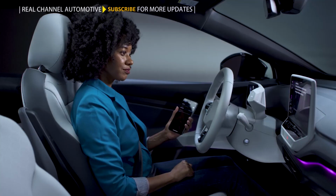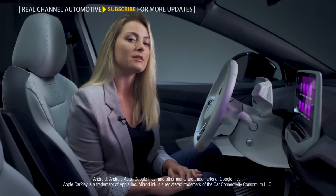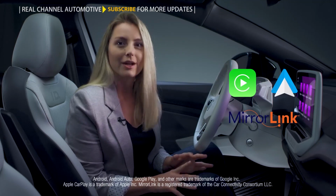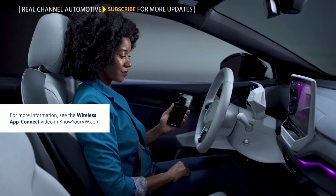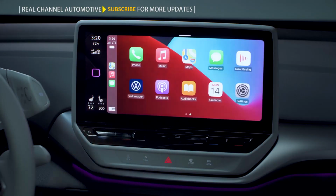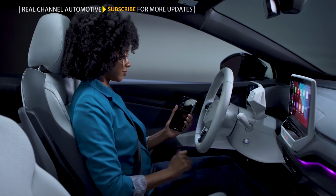With App Connect, you can display and access select apps on your phone in the infotainment display using Apple CarPlay, Android Auto, or MirrorLink. Open the App Connect menu. Select the mobile device as well as the operating system. Confirm the authorization request and agree to all prompts.